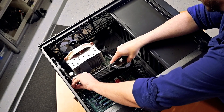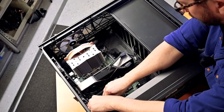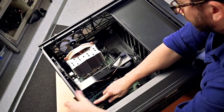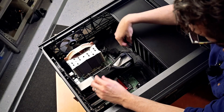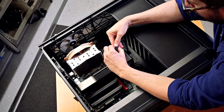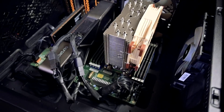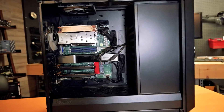I like to have a little extra performance on the networking side, so we're sliding in a Mellanox ConnectX-2 SFP+ 10 gigabit per second card. For a bit more storage we've got some Intel Optane 900P SSDs — these are 480GB each with amazing queue depth performance. Finishing up the cabling — really do like how this is coming together. If you're interested in using an EPYC system as a daily driver, hit like and subscribe so you get notified when those findings videos drop.